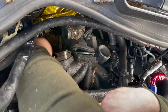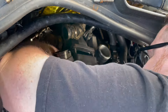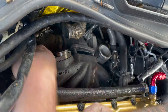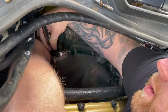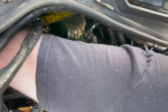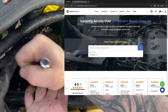The manifold situates between the turbo and the block so getting access to all the bolts underneath is a nightmare. I just need to bolt the turbo manifold onto the head and get all the nuts clamped down evenly to make sure everything is clamped down square - we don't want any more bowing issues. Once that's done I can bolt the turbo to the manifold and start getting the rest of the kit back on: the wastegate, boost pipe, exhaust - we're into the home stretch now.